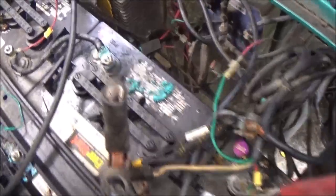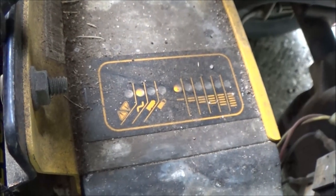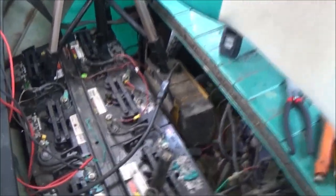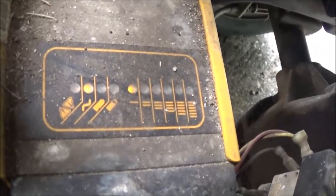I may bring my charger out and disconnect it and bring each battery up just enough for it to maybe take a charge. So what I did was put my battery charger on here and let it charge for a little bit. The light on the right tells me how much charge is in it; the one on the left says it's charging — it's no longer blinking red. I've got it plugged into the regular charging system. We're going to let this charge for a while and see if we can get them to come back to life.